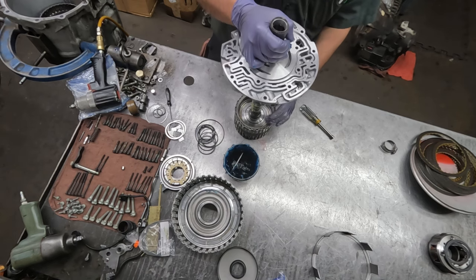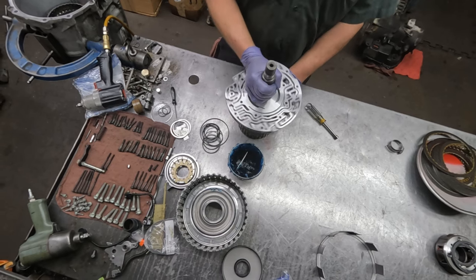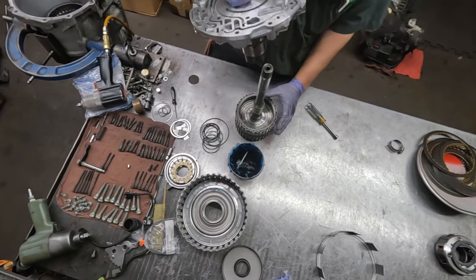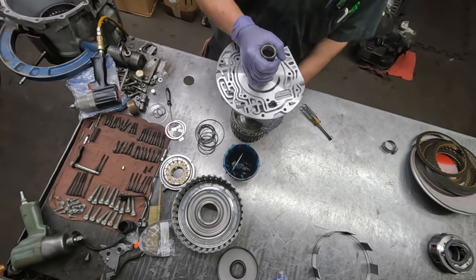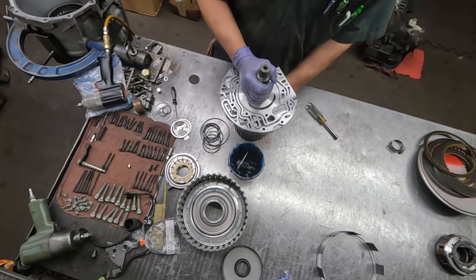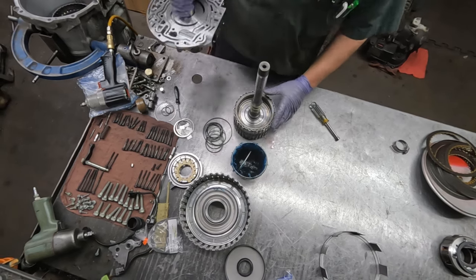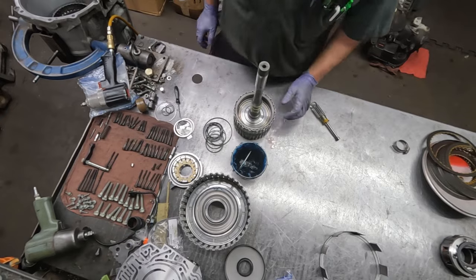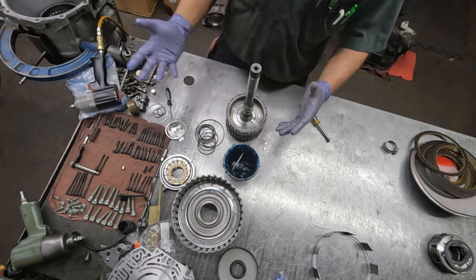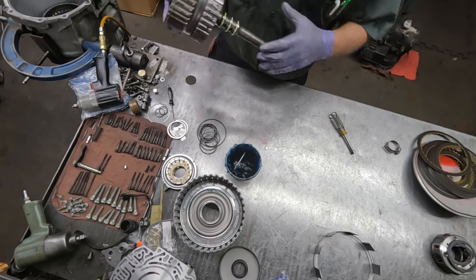The best thing to do is center the rings in their grooves, so this can slide on without cutting off an edge. Take it off and on a few times, and that tends to work them in, to where now we have the confidence that when this all gets put together, these rings won't be sticking out and possibly get cut off during assembly.